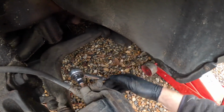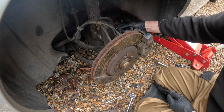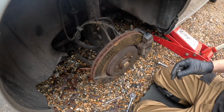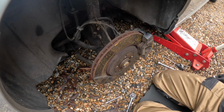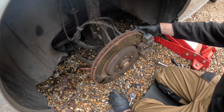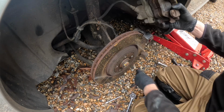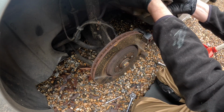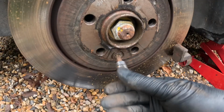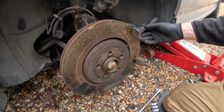So there's 2 bolts, one upper, one lower. The bolts are like the slider carrier pins. Second one. Bring off. Caliper off. So support the caliper so there's no strain on the flexi hose. Holding on the disc, so it's a T50. Let's put a screwdriver in the vane.